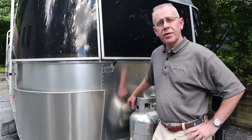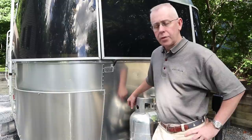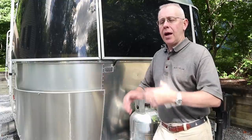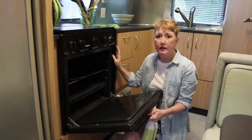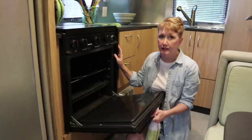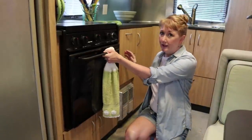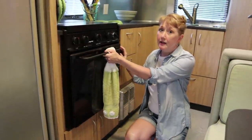The other reason is the possibility of a loose connection. Most people say, well if you get into an accident your propane could be running. I don't care about the accident part - what I care about is just a simple connection coming loose and then allowing propane to flow into the RV. In 2015, I did have a gas line separation while traveling. Fortunately I was just heating up buns. I had trouble lighting the pilot light and didn't realize I was lighting the gas line. It finally got lit, I closed the door, and the next time I opened it, it went whoosh. I immediately slammed the door closed and turned the gas off - but it can happen.